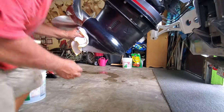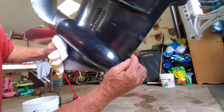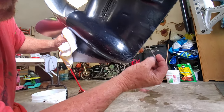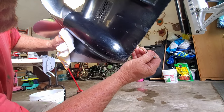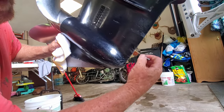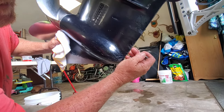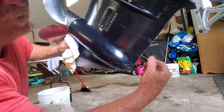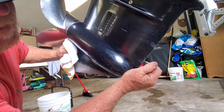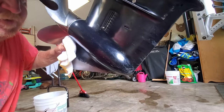My speedometer quit working. If your speedometer off your motor quits working, you'll find there's a little tiny hole right there — it gets grass and sticks. Take a drill bit, don't put it in a drill, just take a drill bit, find that hole, and slowly with your hands work it through. You can see the stuff on the end when you pull it out. That's why your speedometers won't work — it gets a piece of grass, a piece of stick. There's another little trick.